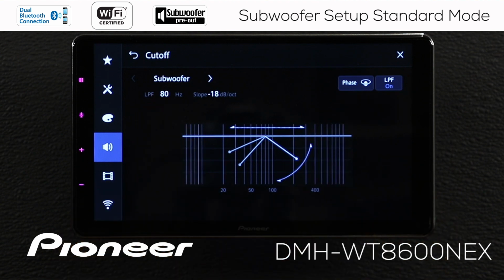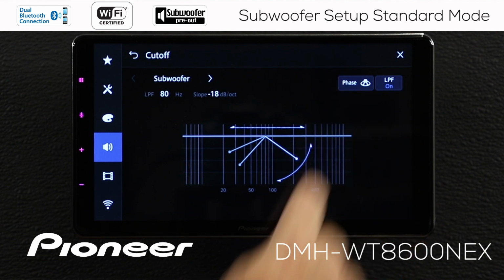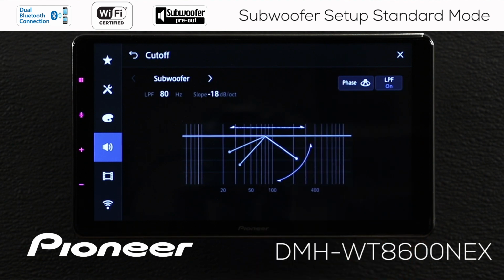We also have an adjustment to the phase, and right now you can see our phase is in normal phase. We can also switch it to reverse phase. Be sure to check both of these phase settings in your particular vehicle. One of them might sound significantly better than the other, and there's no problem. You're not going to hurt the in-dash receiver switching the phase from normal to reverse. Do the one that works best for you in your particular vehicle.